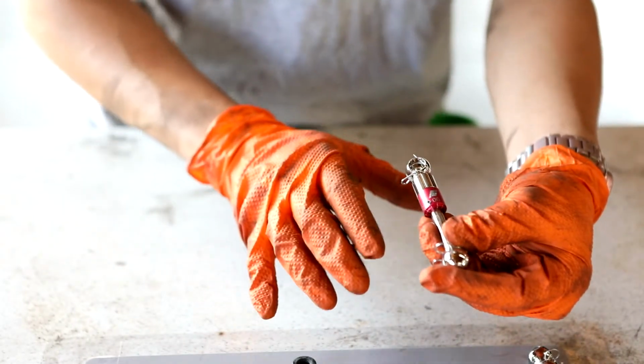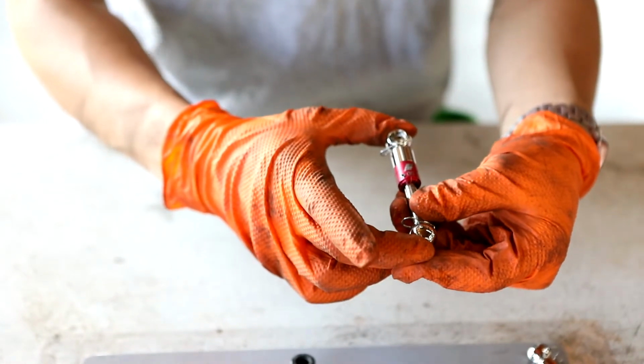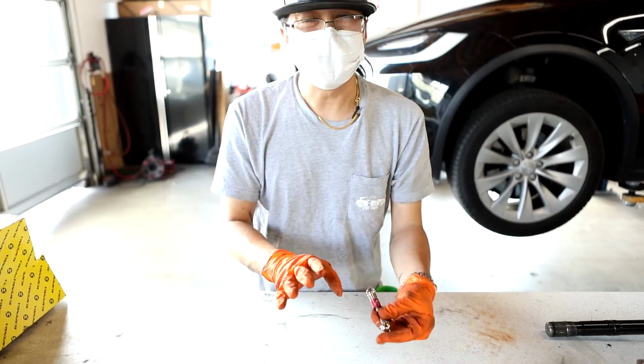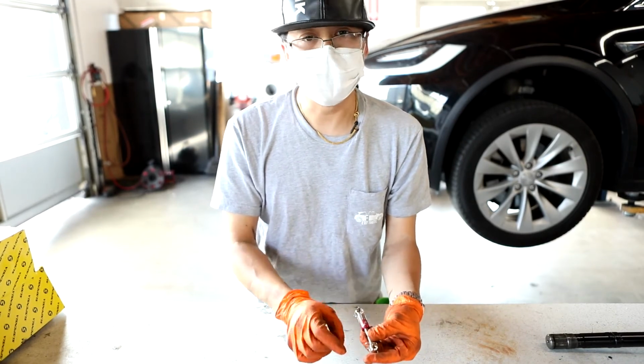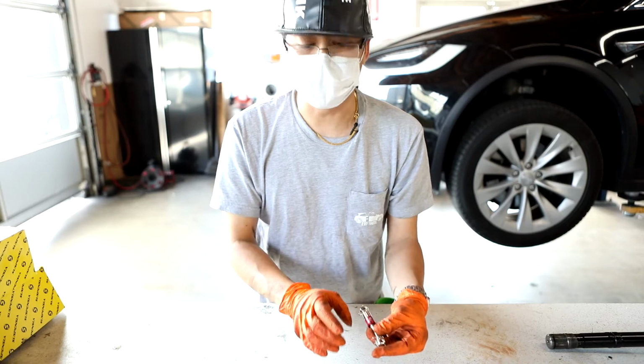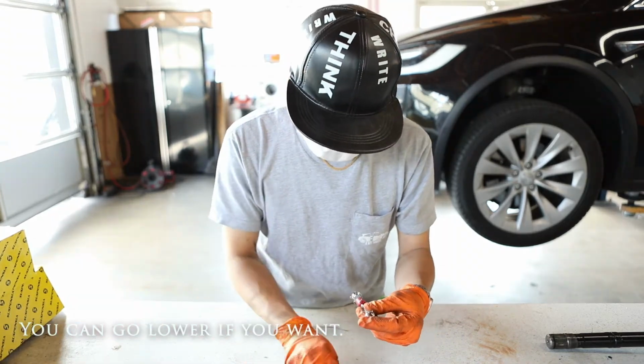We're not dropping the car 5 millimeters. We're increasing the length of the lowering link 5 millimeters, and that will give us a sporty drop, not an extreme drop. You'll see a little bit of a drop, but mainly we're interested in reducing the acceleration shudder, and a -5 will give us that.